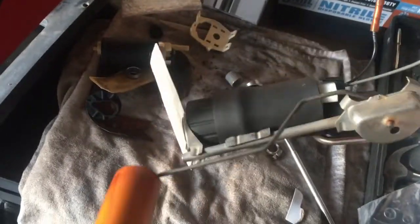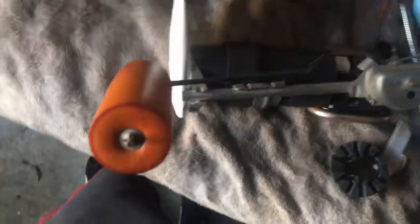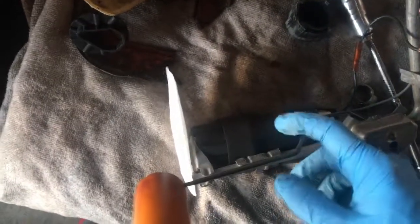Here's the fuel pump all assembled with the new fuel strainer or fuel sock. It's a little ugly — I had to do what I had to do to get it to work. Basically, whatever this rubber-plastic piece is, all of this is to prevent vibration on the fuel pump since it's rubbing against metal. You want as little vibration as possible so the fuel pump doesn't shake and kill itself. So I used everything that came in the kit and created something to help prevent it from rubbing metal against metal and vibrating all over the place. Now it's ready to go in.